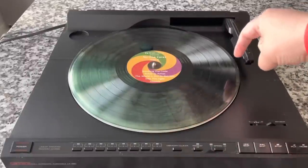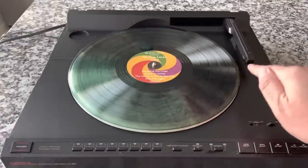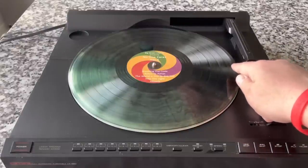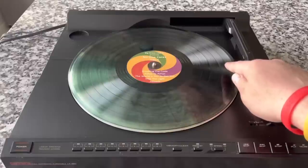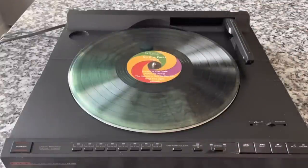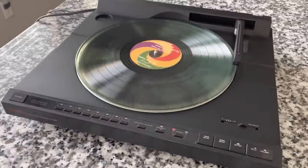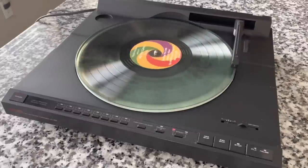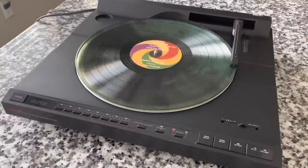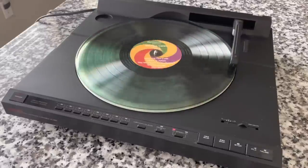What it does when we first get it going is scan the entirety of the record, shining a laser down. It uses a laser and a refractor sensor — it shines that beam and where it's shiny and smooth, it'll reflect back and record that position, identifying track markings. Pretty significant technology, pretty impressive. If I just hit play, it goes across, finds the start of the record, drops the stylus accordingly, and will play through just like an automatic turntable — bringing the tonearm back home and shutting itself off when done.